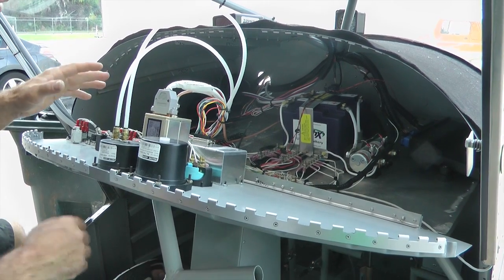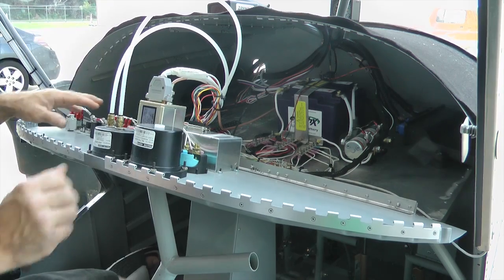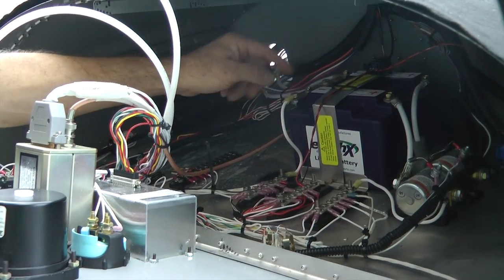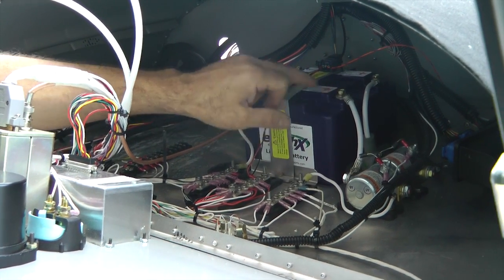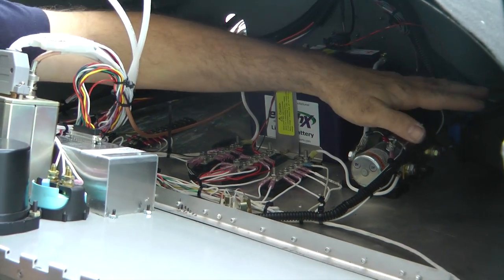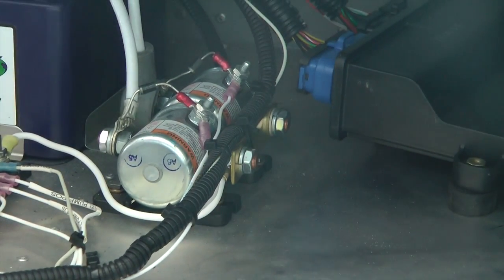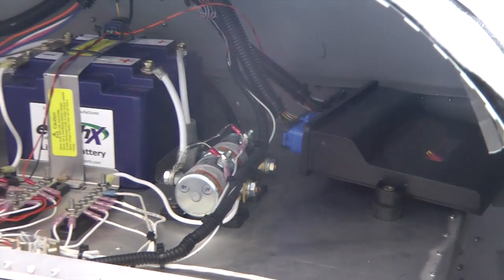This way you can lay out your electrical system on a piece of paper, or you can just take your components and put them here. Like we've got our buses, we've got a junction area over here, we've got our batteries, bus bars across the negative, we've got our solenoids for one battery with our diode, we've got a solenoid for our backup battery, we've got a computer that operates the engine — basically everything that we would need. And then we also have a wire bundle that has enough slack in it in order to bridge across to this fold-down panel.